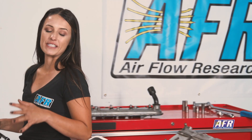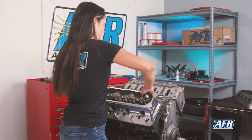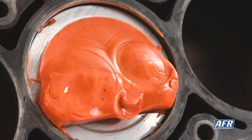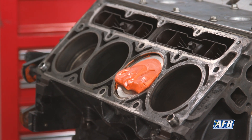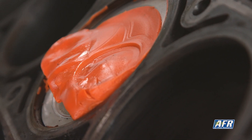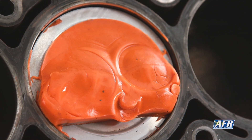Now let's take the head back off and see what we've got. With the head off, we can see how the clay imprinted. I did use a little bit more clay here than you would typically use, but I really wanted to exaggerate the intake and exhaust imprint. This isn't an aggressive combination — it's actually a stock block — so you have a dish piston and you don't have valve reliefs, so you won't see quite the impression you'll probably see with your combination. You do still see the intake imprint and the exhaust imprint, and we will be able to see what our clearance is and where the tightest part is.